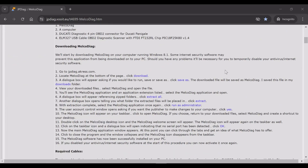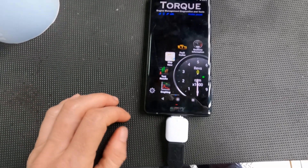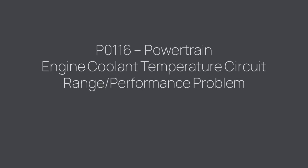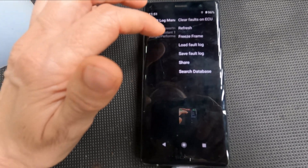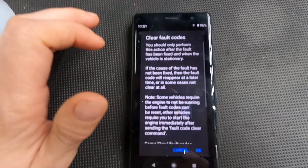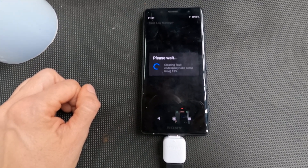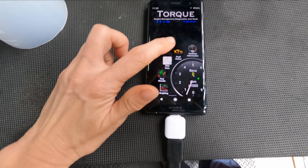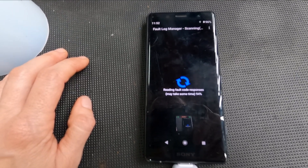The ignition does need to be on but the bike doesn't need to be running. Torque Pro has an error code reader and it found the error — P0116, powertrain engine coolant temperature circuit range/performance problem. That's exactly what I expected to see. So I'm clearing the code now, because I'll be disconnecting the battery to get access to the temperature sensor and I want to be sure the new sensor starts with no error codes already present. All cleared.